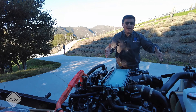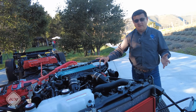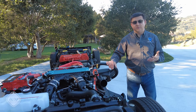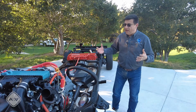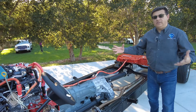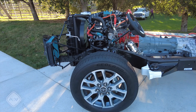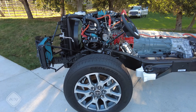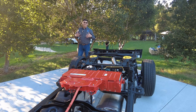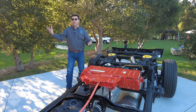In front, we still have a powerful twin-turbo V6, and unlike other Toyota hybrids, this still runs on the regular Otto cycle. A lot of folks don't realize that many of the fuel economy improvements in vehicles like the Camry hybrid, Prius, or RAV4 hybrid come not simply from adding electric motors, but from aerodynamic improvements, rolling resistance improvements, and converting the engine from an Otto cycle to an Atkinson cycle, which is more efficient. Toyota didn't do that here because they didn't want to give up torque — the Atkinson cycle trades torque for improved efficiency, and when you're towing or hauling 10,000 pounds, you need a lot of torque.